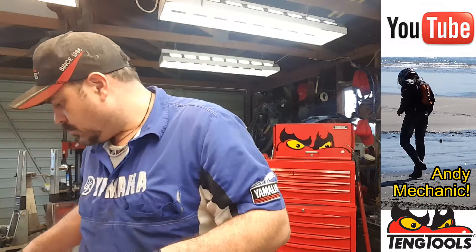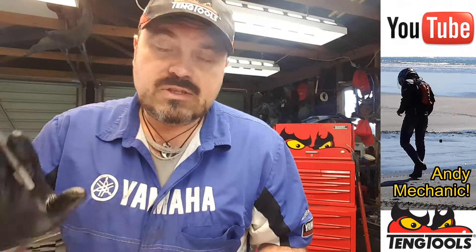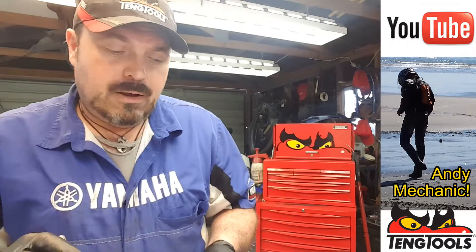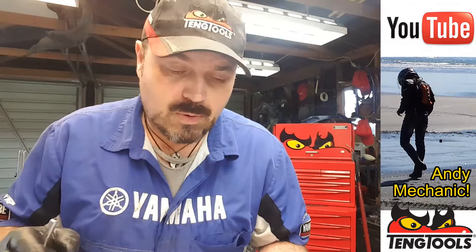Toyota give us a specification, and that specification is: when it's new, it's somewhere between 42.11 millimetres and 42.01 millimetres — that's their tolerance for a brand new camshaft. It's allowed to be worn down to 41.9 millimetres. So if you're unlucky and get a camshaft at minimum spec when it's made at 42.01 millimetres, then it's only really allowed to wear 0.1 millimetres before it's scrap.